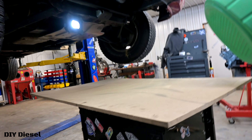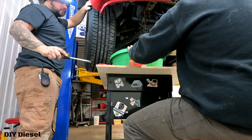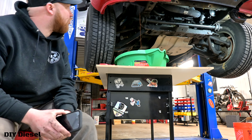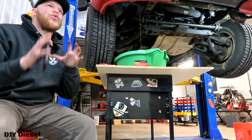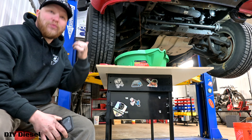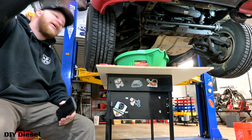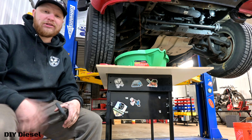This is a five-gallon bucket. I think there's about four gallons of coolant in our trucks, so this should be good. Now it's draining — it's more of a sustained, controlled drain. Otherwise it's just going to go all over. We're going to let this drain, drop the truck back down, and start the process.